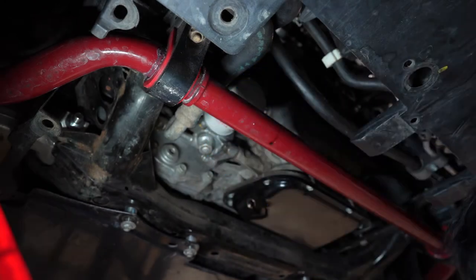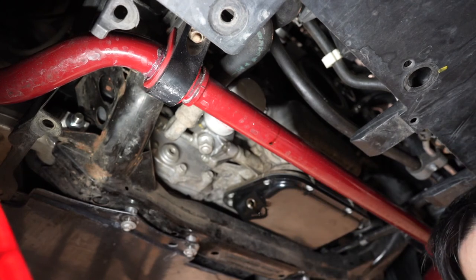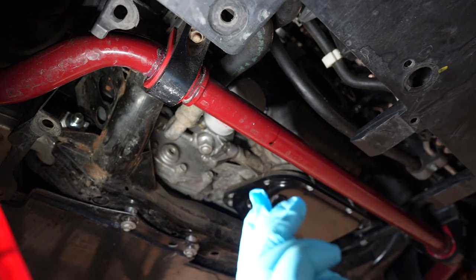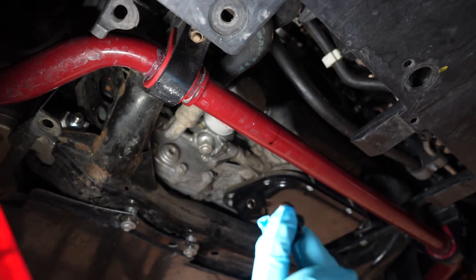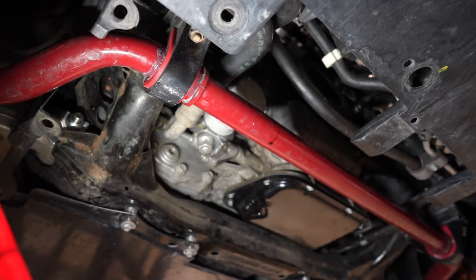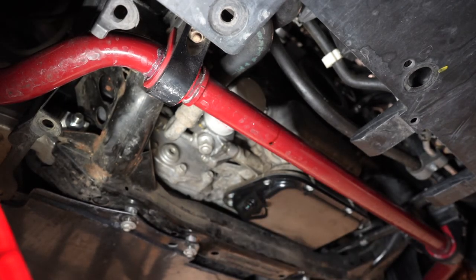Make sure it's all seated down and we're good to go. Once the oil starts to slowly drip, you're ready to put the oil drain plug back on. Double check and inspect the plug, make sure the new gasket is on, and then we're good to go. For you guys that are technical, the torque spec for the GTR is roughly 22 to 26 foot-pounds to torque it down.